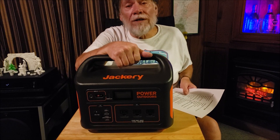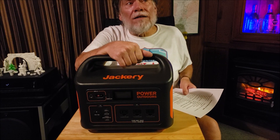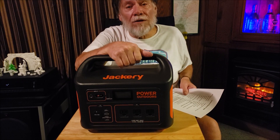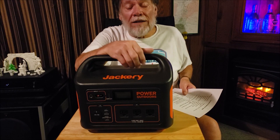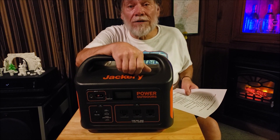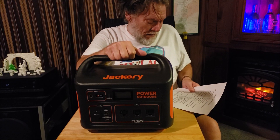I'm planning on replacing my whole solar setup except for the panels — the batteries are coming out of my front box. My solar charge controller is just a regular PWM, but this already has a charge controller built in. I've got my whole front box to reload, plus I'm taking weight off my front tongue. On the runaway, you're only supposed to have a maximum of 100 pounds up there — 44 pounds in just batteries doesn't leave a lot of room. This isn't going to go on the tongue; it's going inside on the shelf.